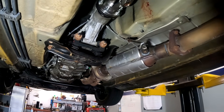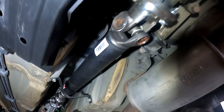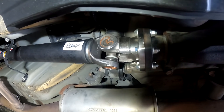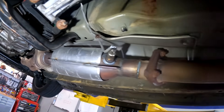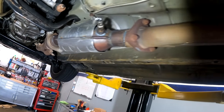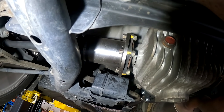We work on these cars a lot, so we thought we'd seen everything - but this driveshaft is very odd. It looks like a universal driveshaft that can be made to fit anything. It's got adjustability right here and then nut and bolts instead of threaded, which is kind of bizarre. It's got an aftermarket catalytic converter, but it's fine - it has the O2 in the cat, so that all works. Aftermarket axles too, just slightly different looking with different flanges.